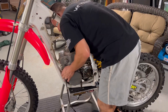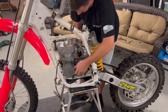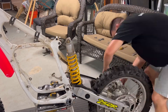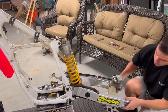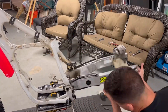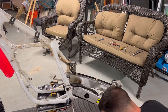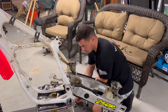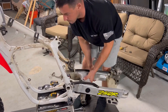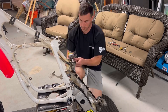Once I get the motor mounts fully out, I'll remove the upper shock mount to give more room to get the motor out. Next I'm removing the rear wheel and taking the shock off — the linkage is still connected. That was a 19-millimeter, pretty tight fit trying to get sockets in there, so you need an extension. I've done this plenty of times before with the other CR250 I had, so I remember all the bolt sizes.